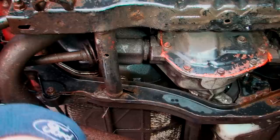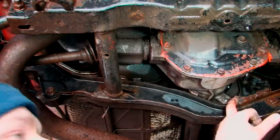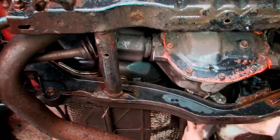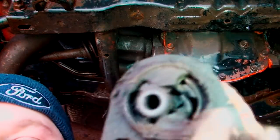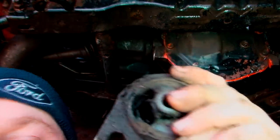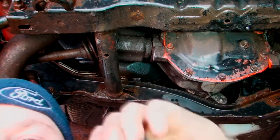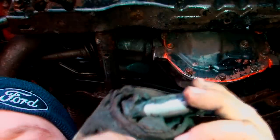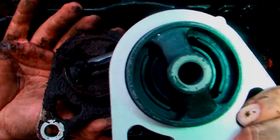I normally say you can take things off to make it easy, but in this situation even if it takes me 10 to 20 minutes to wiggle this out, I will do that — it's going to save me time and hassle. Oh, why would you look at that — it came out! As you can see this bushing is just gone. I can push the whole middle out; there's just a tiny bit of rubber holding it. That is completely gone compared to what it's supposed to look like. So that one came out sorted.